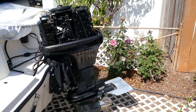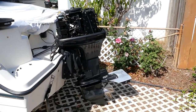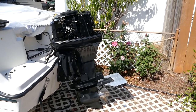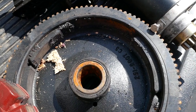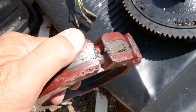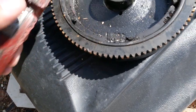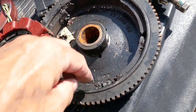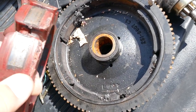I'm going to run through what started the whole problem and what the mechanics have done to try to fix it. The short end of the story is the motor turns but it won't start. What happened is one of the magnets came loose on the flywheel, and as it was spinning - I was out on the water when it happened - by the time I got back, the stator had been cut up a little bit. It was still running and got me in, maybe 10 minutes.